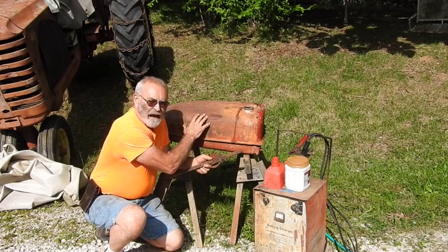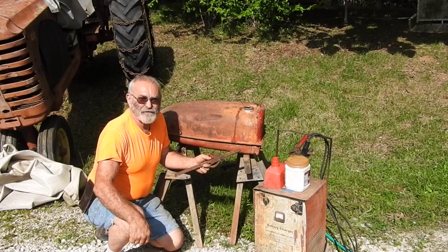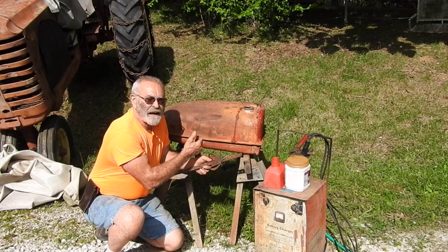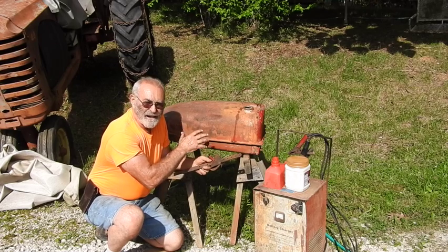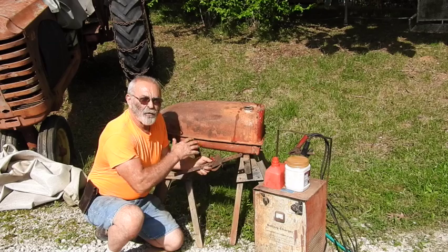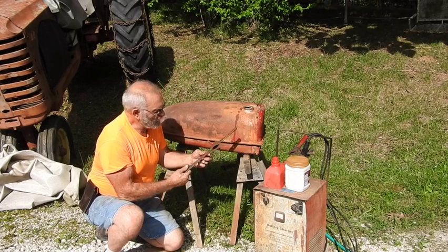I have to tell you, I did this tank back in May of 2020 and it's just been sitting on the side. I hadn't had the opportunity to completely finish the project, so it's surface rusted on the inside. I'm going to clean up that surface rust before I go ahead and dehydrate it and treat it this time, because I don't want to put that surface rust underneath the coating. This time we're going to finish it up and complete it.